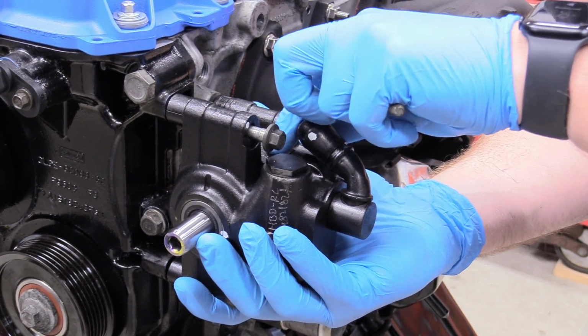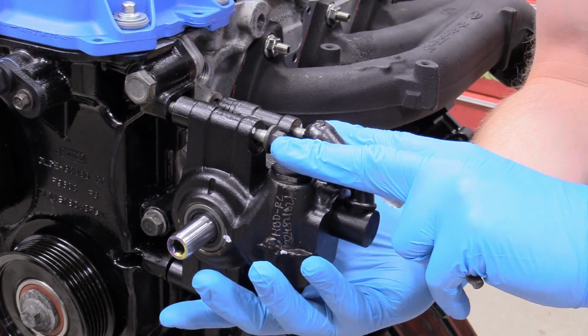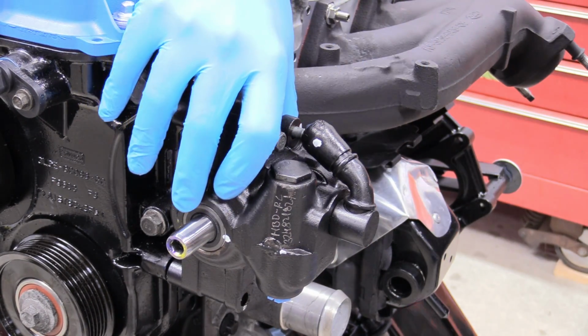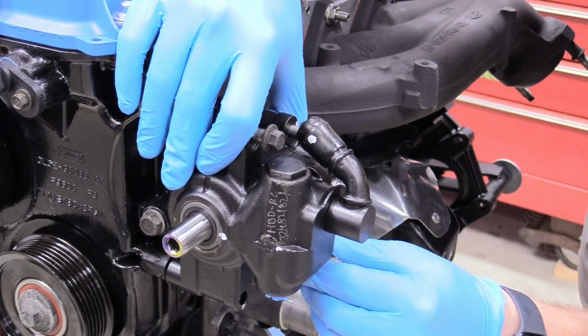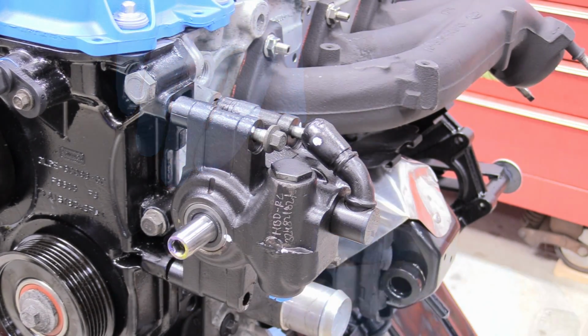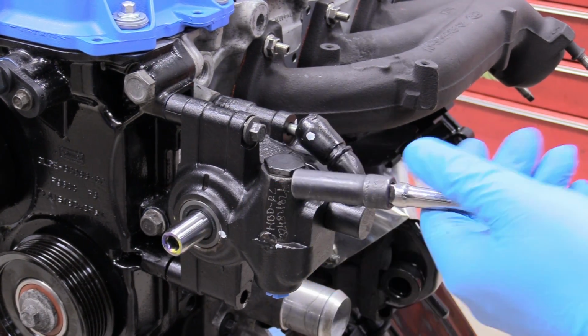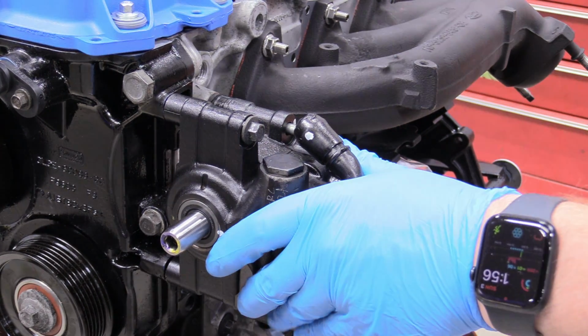And on the bolts, it has 3 that hold it in. So there's 2 normal looking ones on the top, and then this one with the stud kind of sticking out the top. That one goes on the bottom right, if you're looking straight at it. They're 10mm headed. You can just start bringing those down. Don't go all the way all at once.